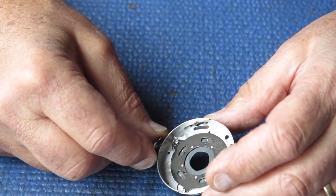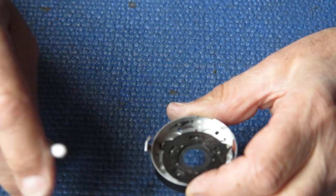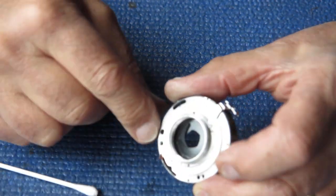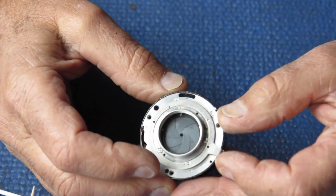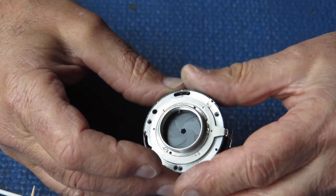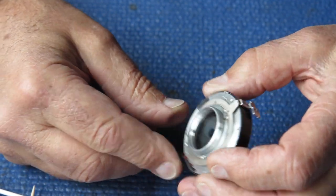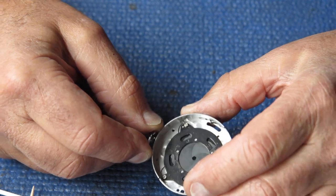So there you have it - that's how you damage the diaphragm when you're cleaning them. This is the front of the shutter, and all that's required to damage it is to press on one of the blades. Typically it's not the blade you pressed on that caused the problem - it was one of the blades behind it. If you stop when you pressed those blades out of position and popped them back into place, you'd have no problem, but typically people don't. They move the lever, the blades pop completely out of place, and before you know it the diaphragm looks like the one in the shutter I repaired. Thanks for watching.